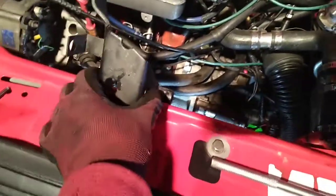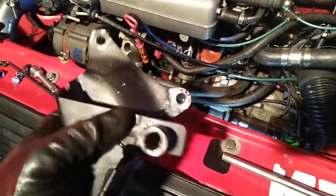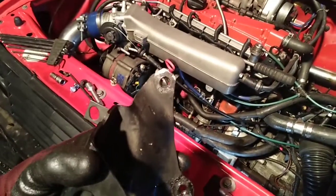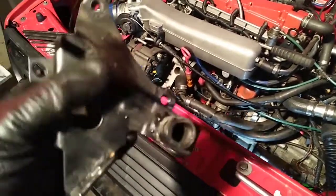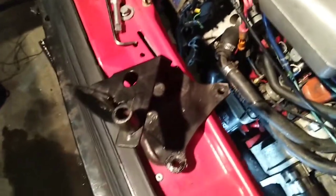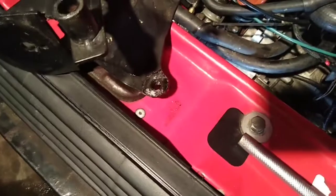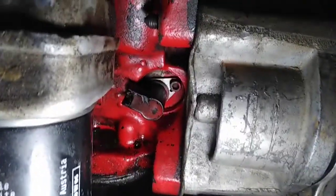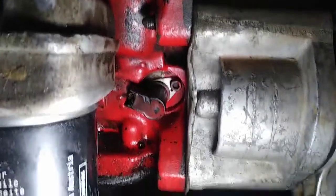This is the engine mount as it sits in the car - this is the front. It has one single 16mm bolt, one that goes to the starter, and another longer one that goes back here, so these two bolts are right next to each other. Then there's one on top. These two have threads in the back and this one has the thread in the front - the starter mounts on here. These two bolts also mount through the starter and through the gearbox, and I think through the block as well. This one goes to the block and the top one goes to the block. So you have to remove all three or four of those bolts, and then you get your crank sensor - you have to remove that cap screw and it should be out.